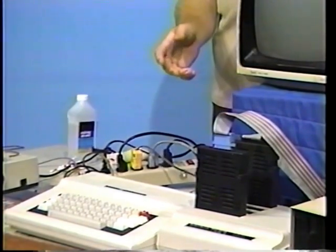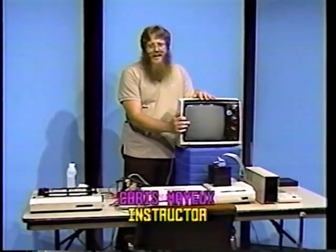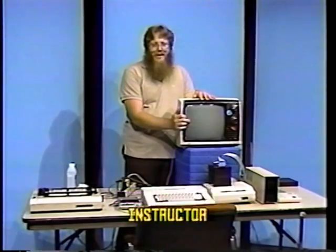If all goes well, you should get a power-up message and copyright information on the screen. If not, go over this simple list of troubleshooting procedures. Poor reception or fuzzy display. 1. Make sure TV set is on channel 3. 2. Check that all antenna connections are secure. 3. Adjust contrast and brightness controls on the television for satisfactory intensities.